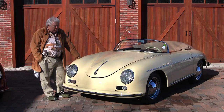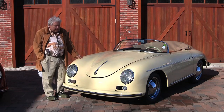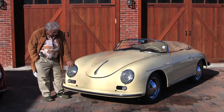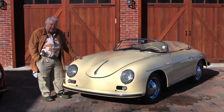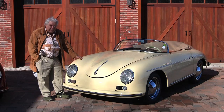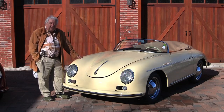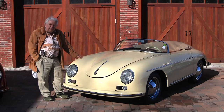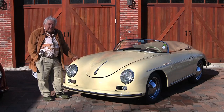Let's talk about a few of the features of the roller that we think are important, because we had to do them last time. Starting off, we've got four-wheel disc brakes. We're going to use regenerative braking on this version, but I still like having four-wheel brakes with another four or five hundred pounds of batteries. I love these headlight grills, but more importantly we're using 6000K bi-xenon headlights, which Special Editions installed for us this time — that's going to be a little bit of a savings. We also have LED turn signals. In fact, all of our lights in the car with the exception of the headlights are LEDs, which uses considerably less of our pack power while providing a little better light.